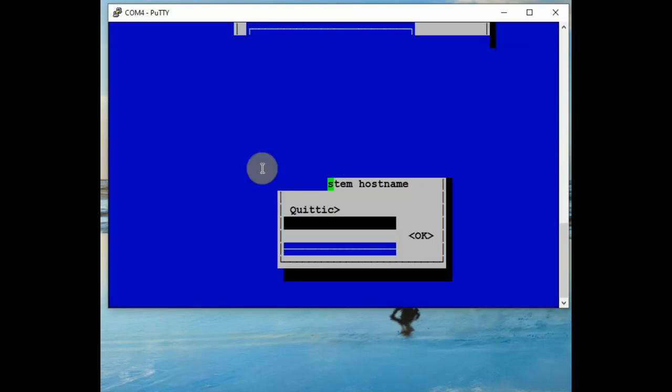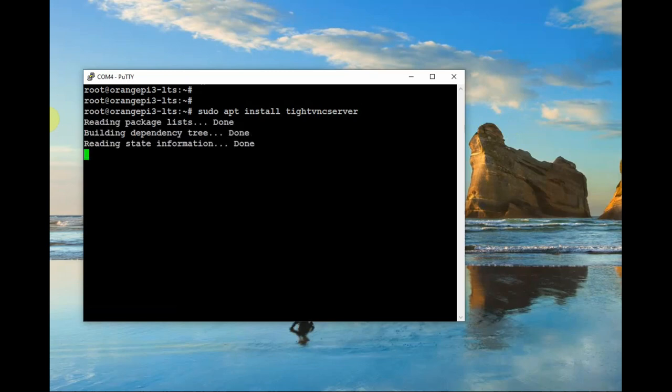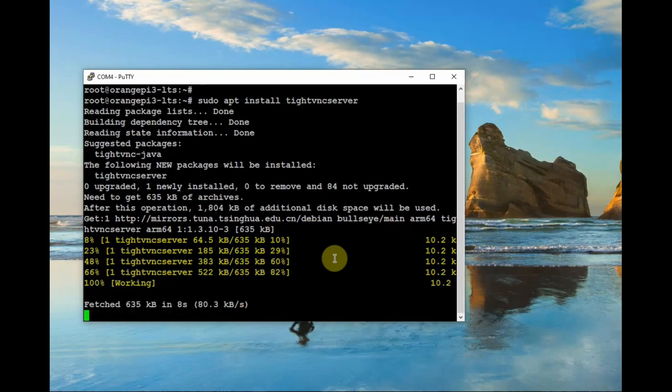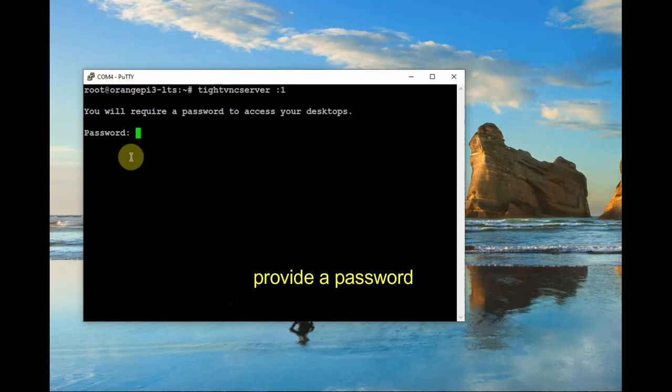nmcli is faster and more effective. Now let us install TightVNC server for a headless view of Orange Pi on your PC, so you can use your PC's mouse and keyboard — you need not connect anything with the Orange Pi for this. Install the TightVNC server. Once installation is finished, start the TightVNC server by typing: tightvncserver :1 — that is session one. It tells TightVNC to listen for VNC connections on port 5901. You have to provide a password and then retype it to confirm.